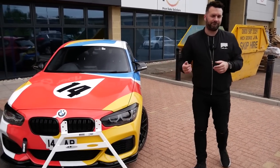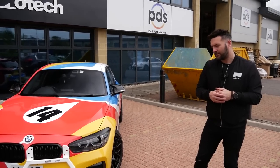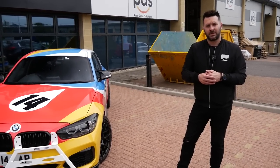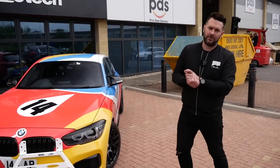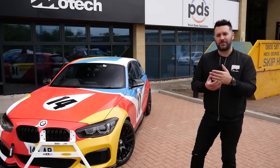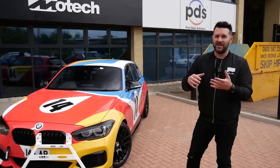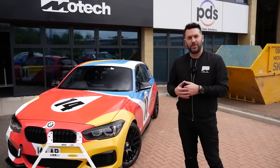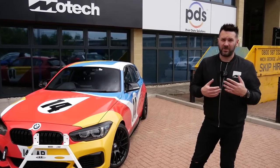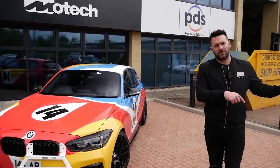Although you've got quite a lot of white on it already. With the bonnet open and the white stripe going down the wing, it'll probably work out quite well. The car won't really look much different after today because with the dampers as well, it's not going to be any lower or anything — it's just going to be how it drives. The dampers are really going to start transforming the car when you're on the limit. It's about controlling the first bump — if you're going around somewhere and hit a bump quickly, it's about getting it settled as quickly as possible for the second bump. Standard dampers don't do that very well. We're running the B8s because you're not running adaptive, so it's a shortened piston bump stop already built into the damper.